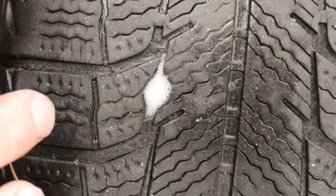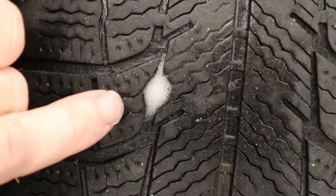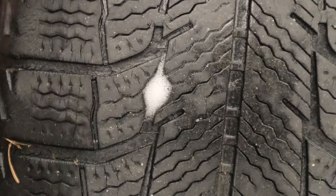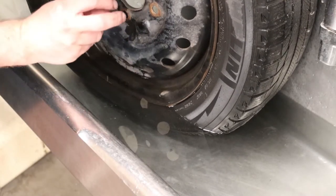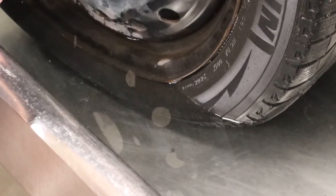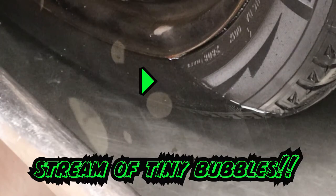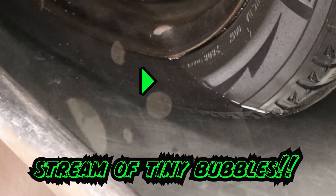Sometimes there's nothing stuck in the tire — it's already been punctured and the object came out, leaving a tiny leak. All the soapy bubbles will have popped but about 15 to 20 minutes in you'll see a little collection, almost like a little bush of tiny bubbles — there's your puncture. For really stubborn very slow leaks, fill your bathtub or a large Rubbermaid tote half full, put normal pressure in the tire, submerge it, and slowly look for tiny strings of bubbles coming out from the tire.